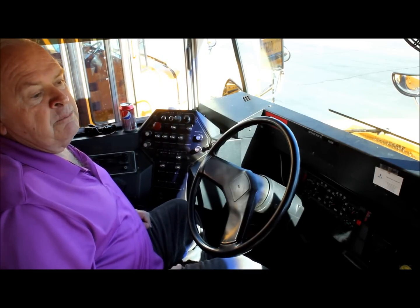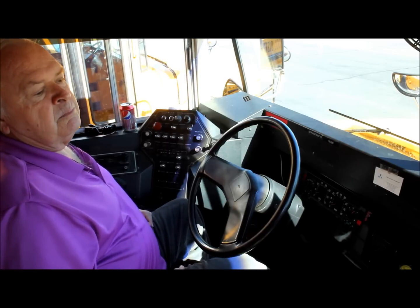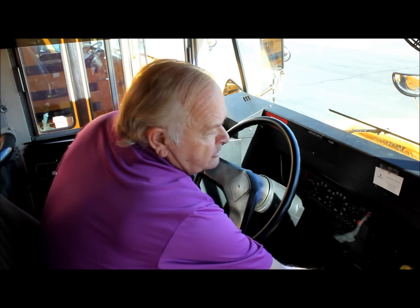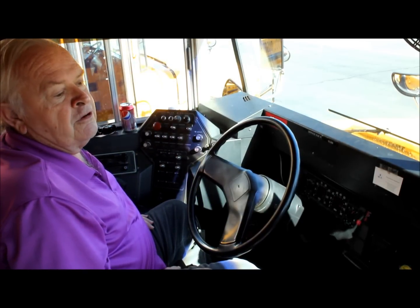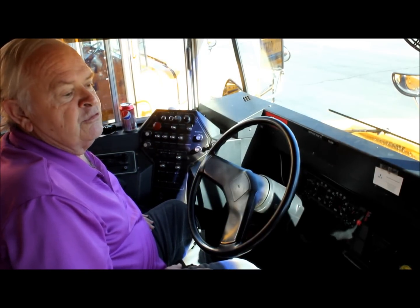There's a hum from our power boost. Holding down, starting the vehicle, and the pedal did move closer towards the floor. This shows that our power boost is working properly.